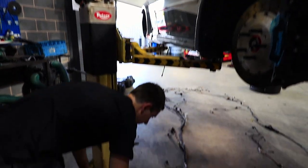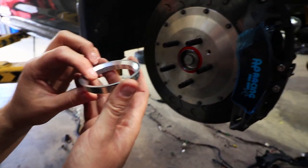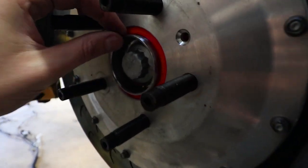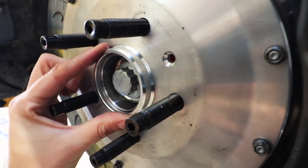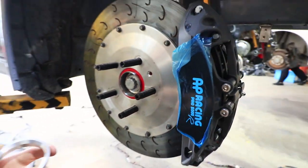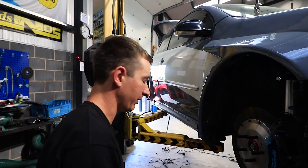One thing while we're on the spigots - obviously the wrong size for the wheels, I need to sort that out. The reason why we're probably going to end up with some custom ones anyway is this chamfer that these have got on. Once we've got the disc, this spacer is going to be nearly flush with the front of that, so you're not going to have a ton to get on. It's sat on the chamfer still - it's not actually centring the wheel. There's no point having a spigot at all if you're going to do that. We'll figure that one out later on.